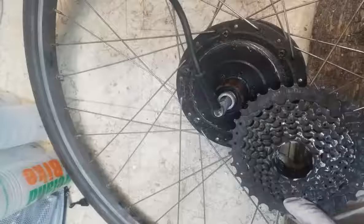Now for the fix. Make sure to take lots of photographs as you go along so that you'll know how the motor goes back together. Remove the wheel from the bike and take off the cassette. You'll need a cassette lock ring tool with a decent sized hole in the middle so that it can slip over the cable coming out from the hub.